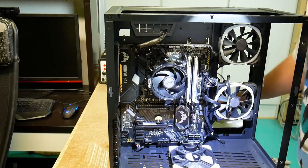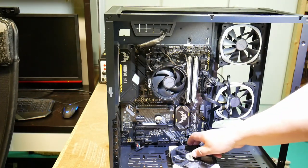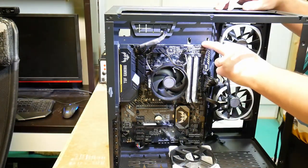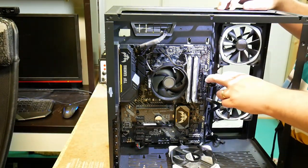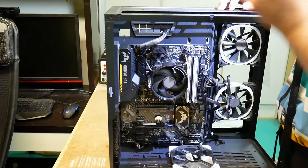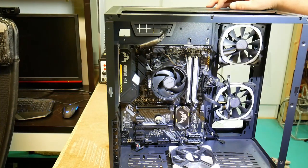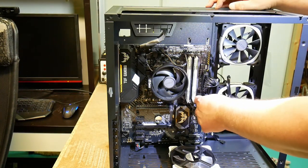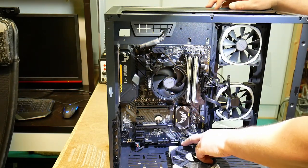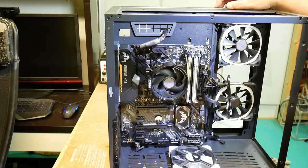So that should be okay now. Ah, let me sneak the cable out of the way of the fan. And then it comes into the back there, so that's okay. So now we had the main board power, the ATX connector, power supply standard, and then we have the 8-pin extra auxiliary for the processor to run. We have connected in USB 3.0 front panel. We have the audio for the front panel, and it's mainly the power switch, which is the most critical.